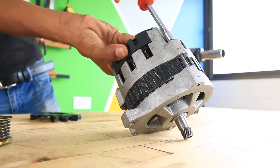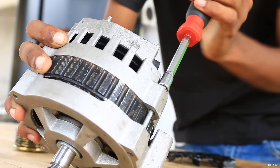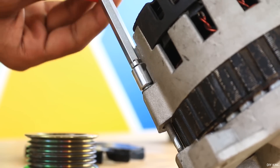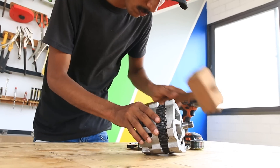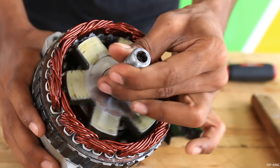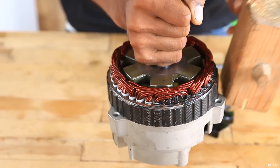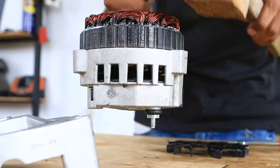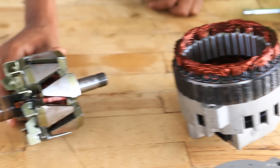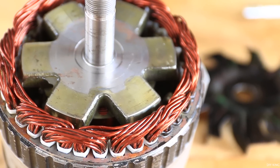We can't change anything about the stator right now, as the whole thing is built around it. So the only thing we are going to change is the rotor and the things related to it — like the carbon brushes and the voltage regulator unit right on top of the rotor assembly. Now you might be thinking: why use these inefficient components if you can generate more power just by using a permanent magnet rotor? Well, the limitation here is engine speed — we cannot control it, yet we need to produce a fixed output voltage, otherwise we'll end up blowing everything. That's achieved using an onboard regulator that decreases the voltage applied across the rotor coil through a pair of carbon brushes as the engine speeds up.